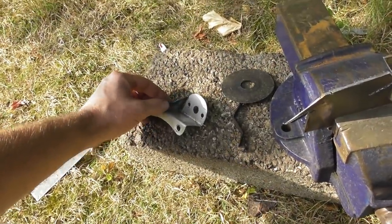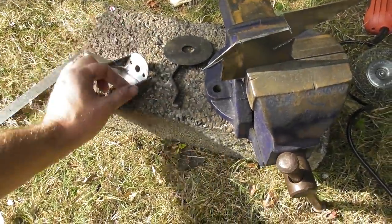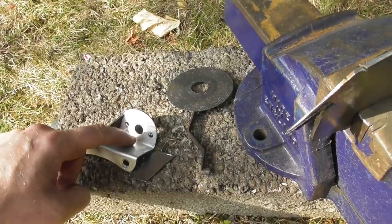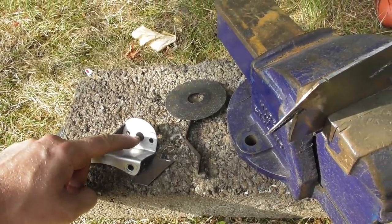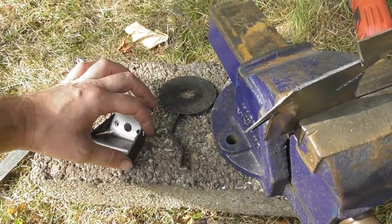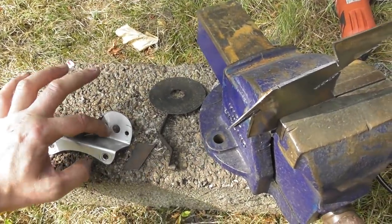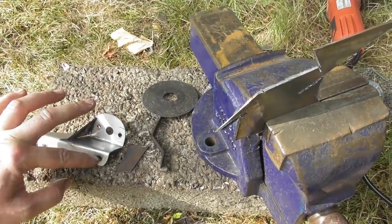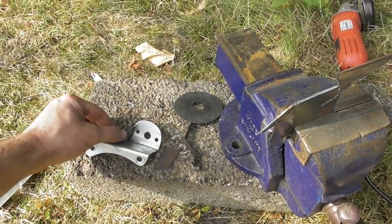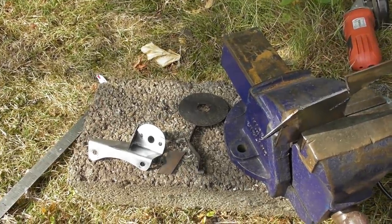Alright, there's gusset number 1. That'll go in like that. Gusset number 2 is uglier, but that will go in somewhere like that. Because the rod is only a very short distance up from there, there really isn't a lot of bending moment, so they might look a bit weedy, but when you think about it, the way this is mounted on this car, it doesn't need a huge amount. You've only got an offset of about 20mm to that bolt, and by the time the bolt head, probably 18mm. So really, I probably didn't need to go this mental, but we're going to do it anyway.